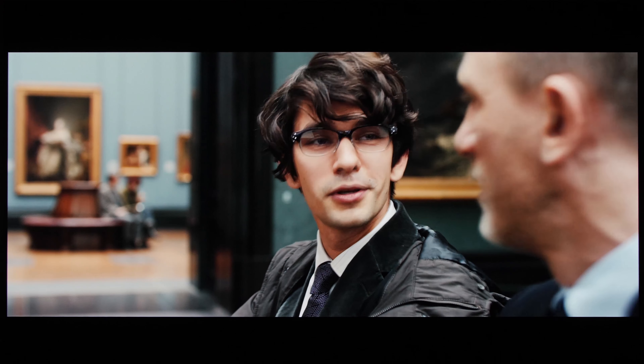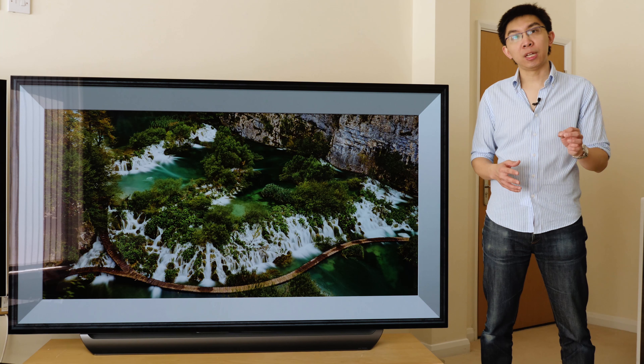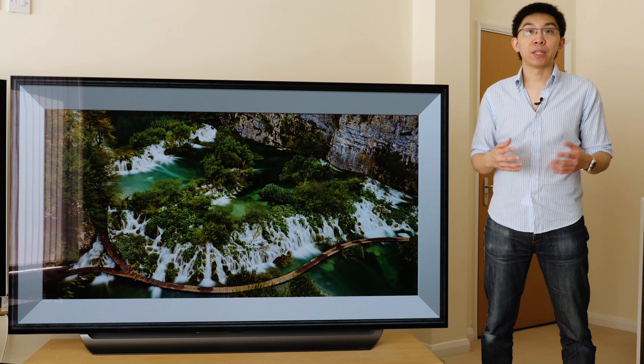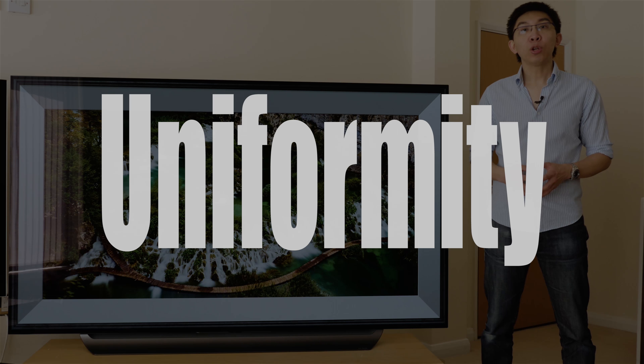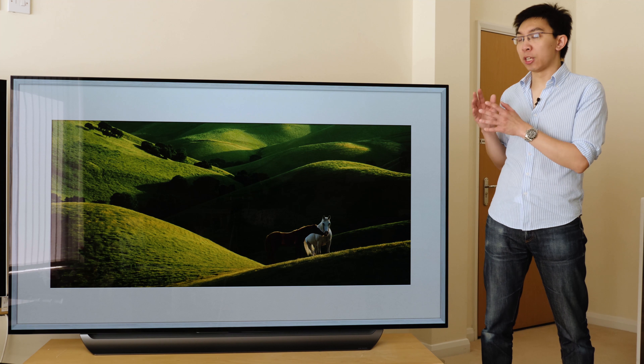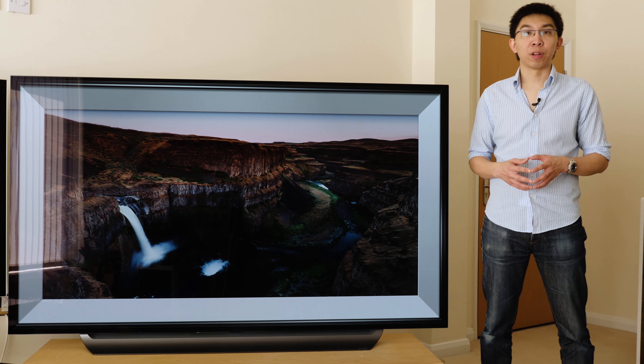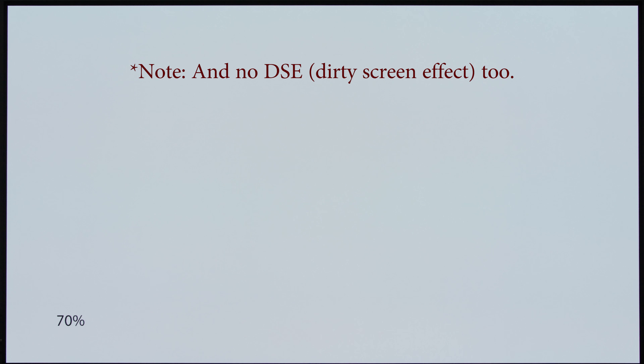Just like 2017 models, the ABL or Automatic Brightness Limiter circuitry on the LG C8 is less aggressive than OLEDs from other brands, meaning that high APL scenes will generally look brighter on LG than, say, Sony or other OLEDs. Uniformity on our review sample was as good as we've seen from a consumer OLED TV, which is particularly impressive given the 77-inch screen size. In a pitch black room, we saw no vignetting or reverse vignetting on full-field slides just above black, although there are still some thin vertical streaks, but no thick vertical or horizontal bands. Bright uniformity was very good too, with no colour tinting across 40% to 100% video stimulus.